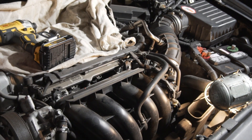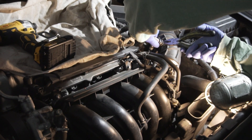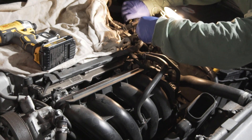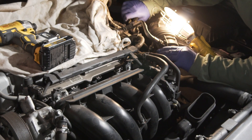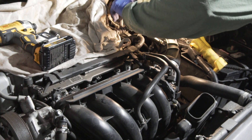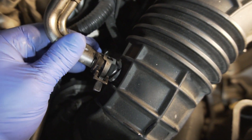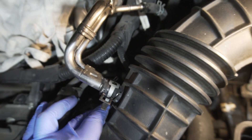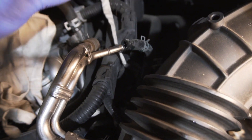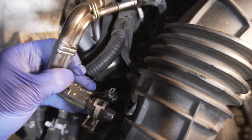With your pliers, we've got several spots — there's a big line right here going into the air intake. Pull this vacuum line down. There are a bunch of vacuum lines. One of them broke out of the housing — that's not good. These are little coolant lines. There's no pliability left in this plastic — it's pretty much hardened. It doesn't even feel like rubber anymore, just hardened plastic. Some coolant came out of it.